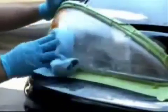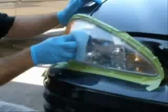Now, with the microfiber towel that's included in the kit, simply wipe the lens completely dry. Now that the lens is dry, take a closer look. If you see any high spots or gloss spots or patches, as you see in this picture, this needs to be re-cleaned with your silicone carbide sheets. Re-clean it before going on to the next step. Now, wipe the lens dry with a microfiber towel.